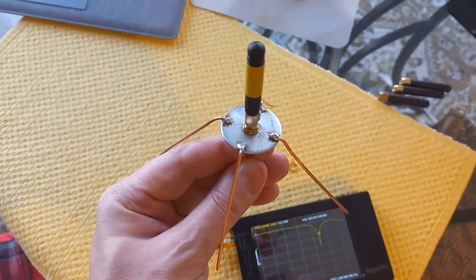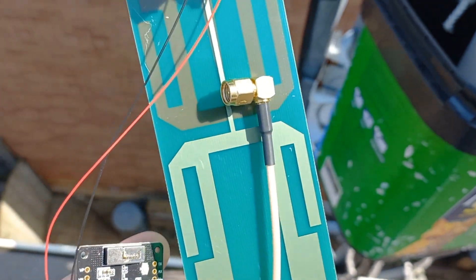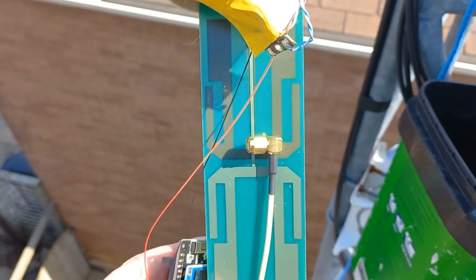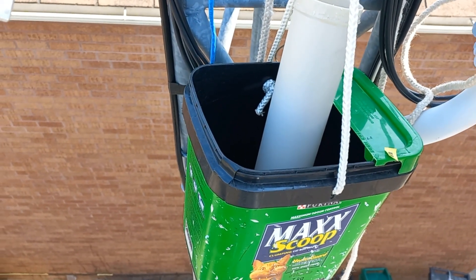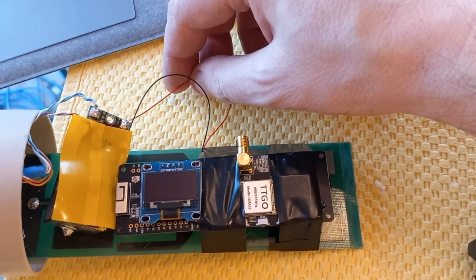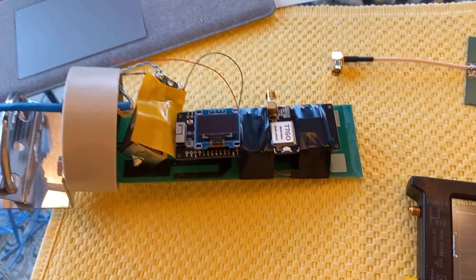Okay, we're going to install this now. I've got it apart here — there's the power supply, T-beam is just hanging out here. I undid the antenna coax, and I'm going to cut it right here. This is the antenna that was in the top, and that's where our new antenna is going to go. Then we'll put the tube back on it. This is how I work with my ropes — I climb first then pull up the bucket with the tools. I had to come down off the roof because when I was working on it up there, I accidentally tugged a little too hard and one of the power wires came off the voltage regulator.